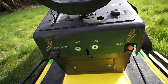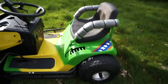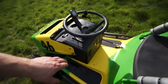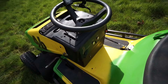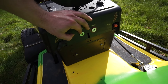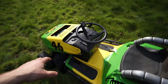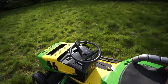For anyone building one of these things, you'll probably find after you lower it there's no space for the battery — usually it goes underneath the seat, but once you lower it down that space is gone. In this one, the battery ended up underneath the steering column and it's pretty hard to get to, so we have two charge points — positive and negative — so you can just connect your charger leads onto it. Also, if the battery goes flat during a race you can put jump leads onto there, get it started, get the jump leads out of the way quickly, and get to the start line.